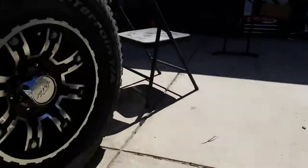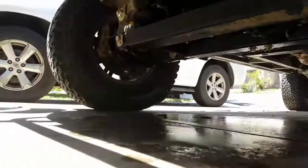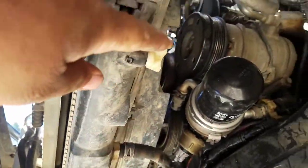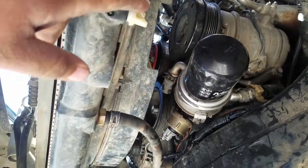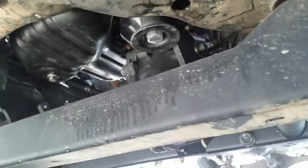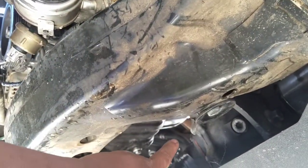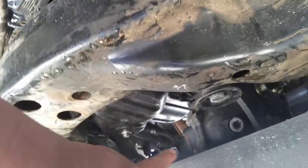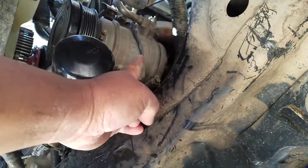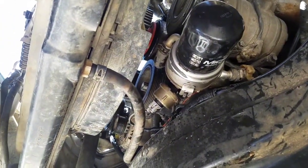There's also a little nipple right here on the radiator — you loosen that so water can come out. There's one right behind here I couldn't get to, like that little water inlet/outlet down there, but that's okay. So that's what you have to do. Now comes the tedious part of disassembling.